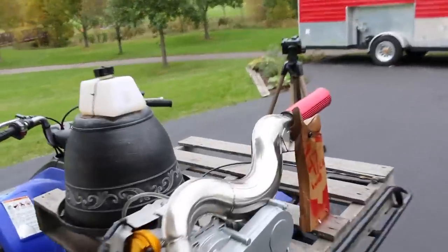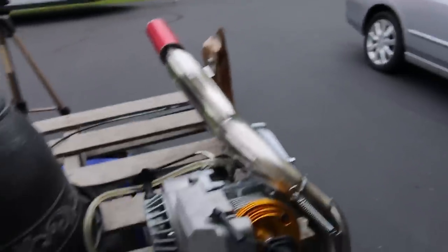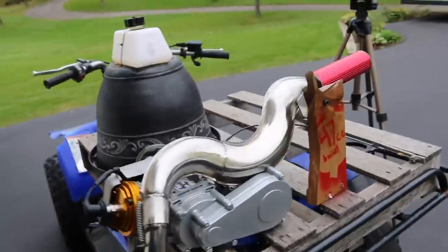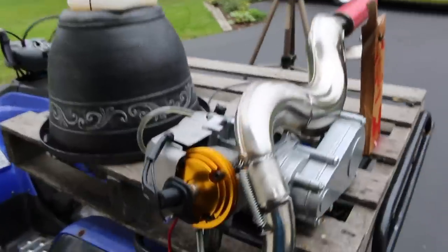While you're in the break-in stages, definitely don't hold the throttle wide open. I would say you can safely burp it, but you don't want to have it wide open whether it's on a bike or on a stand. You'll probably be on a bike honestly, but yeah — take it easy while you're riding. Definitely don't go for your speed passes.